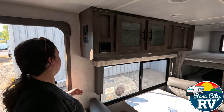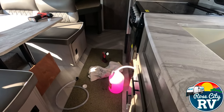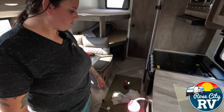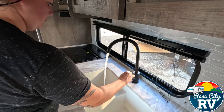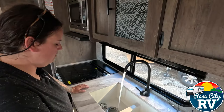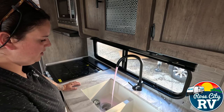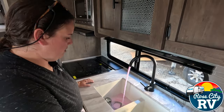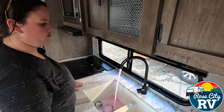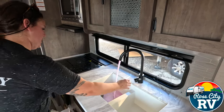This one doesn't have those, so I'm going to start to draw the antifreeze through the coach. I bypassed the water heater and turned the pump — I'm going to hit this and it's going to instantly start to draw. Now that the water pump is on, it's going to draw this antifreeze through until the pump is satisfied. I'm going to go hot — you're going to get air in the lines when you do this because we had drained it down. Now we're starting to get pink. You want to run these for 10 to 20 seconds before you're done to make sure you're getting all that water out and all the antifreeze through. Now rotating over to the cold side — running pink. We've run out of antifreeze.